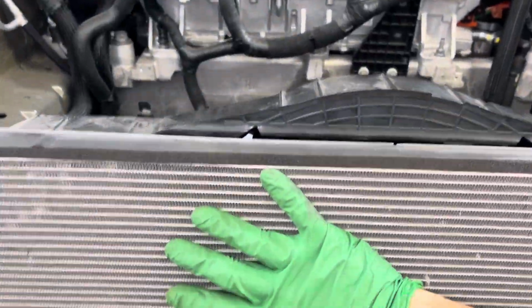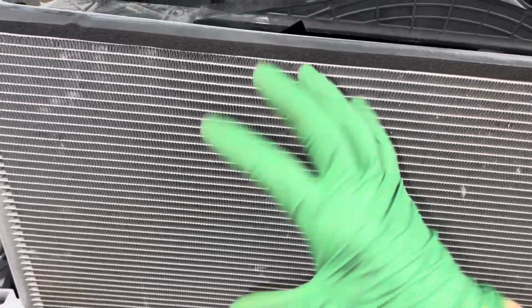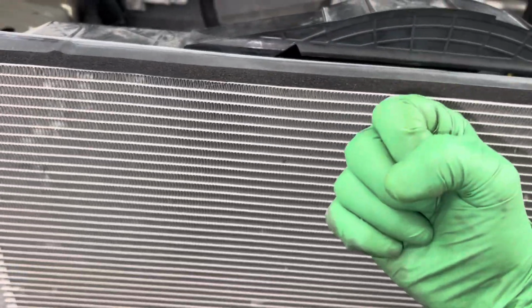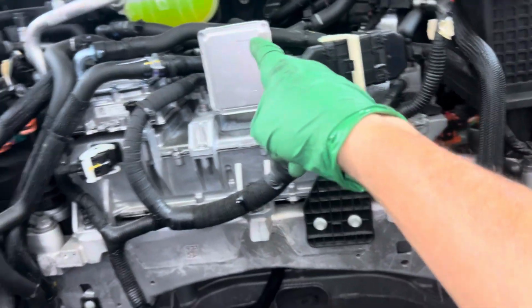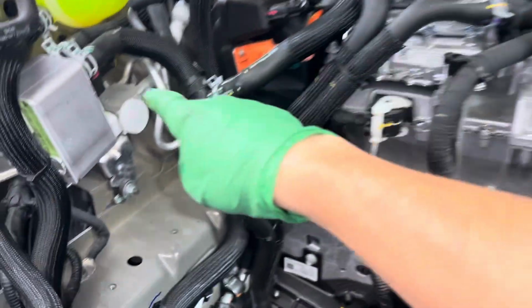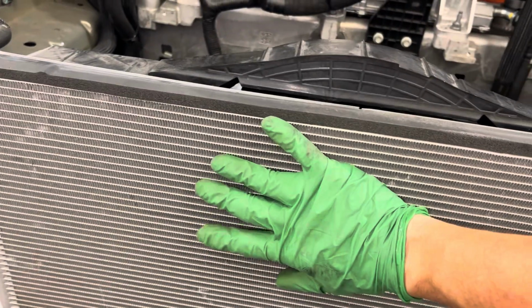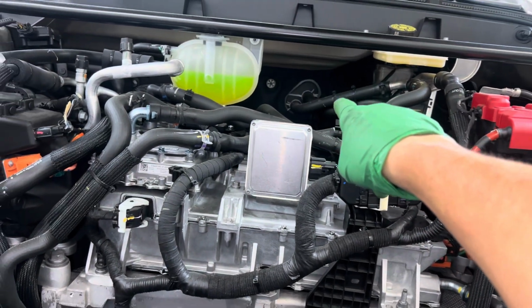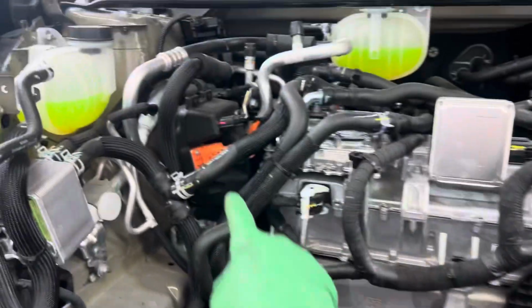So it takes the heat from the outside, even though it's only 35 degrees Fahrenheit outside, it takes that 35 degrees Fahrenheit air, it absorbs the heat out of it, it compresses it, and then the hot gas it throws in inside. Well, on this one, it could do that too if it's a heat pump, but what it can also do is it can heat the coolant with this outside cold air that's 35 degrees out in the snow, and it can heat coolant, and then it can send coolant into the passenger compartment and heat the occupants with hot water from 35 degree Fahrenheit air by compressing it through a compressor.